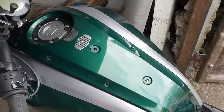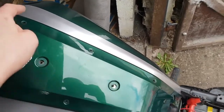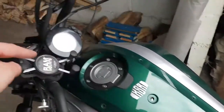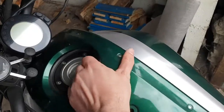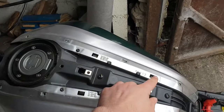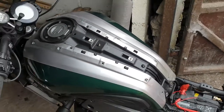The first step is to remove a few allen screws — there's a load of small ones along each side of the center section, and then there are six big ones at the front. Once you've done that you can lift the center trim panel out, which exposes the center section, and then you just have a couple more allen key screws and a few clips to wiggle loose so you can get the side sections out of the way.